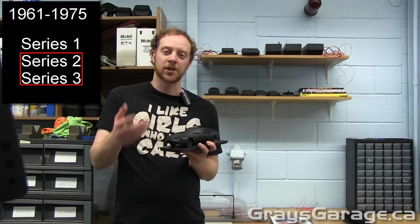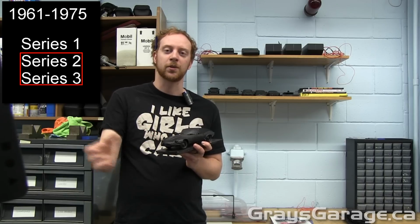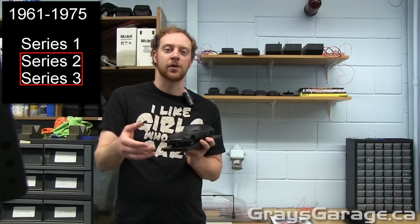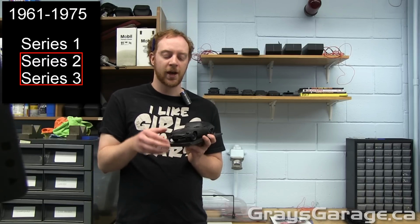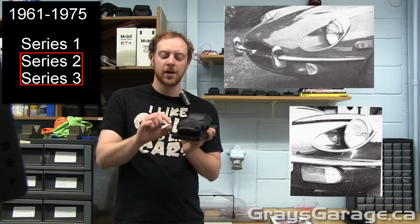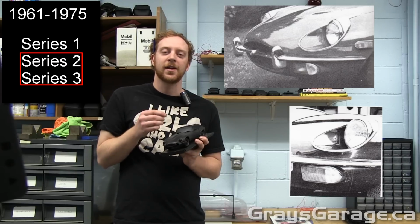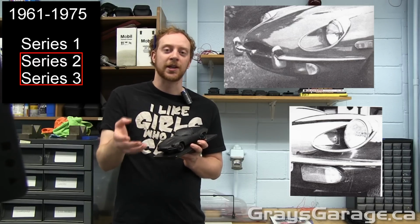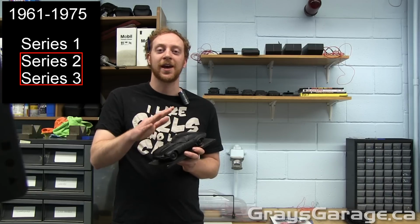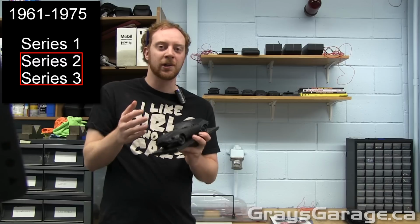One thing that's very interesting, we talked about the headlight fairings. Due to US regulations, when they wanted to bring the car to the US, they didn't allow these headlight fairings because they cut down on light output. So they had to remove those light fairings, and they actually had to move the lights forward so that the headlights stuck out of the bodywork. I have a picture here showing that. That may be good for light output and regulations, but it's terrible for aerodynamics. I've already made a video on headlight drag, the pop-up headlight drag. These aren't really pop-up headlights, but it's a similar idea.